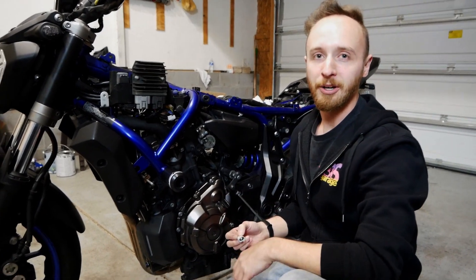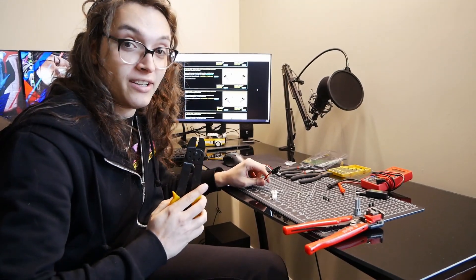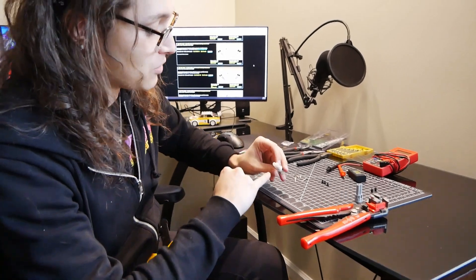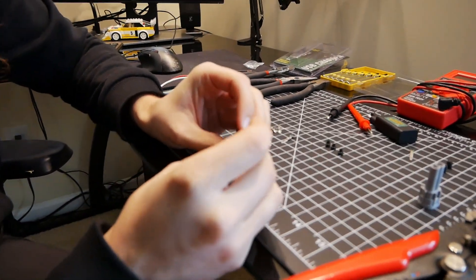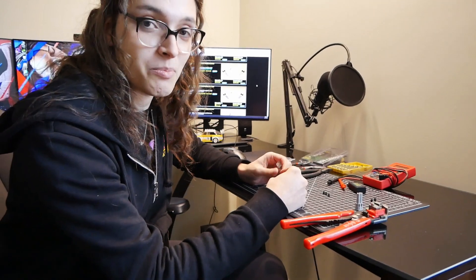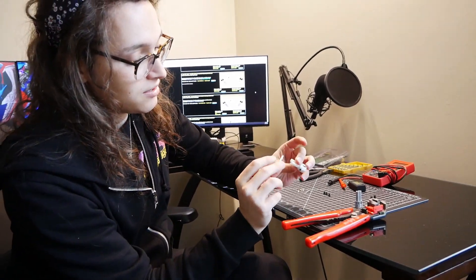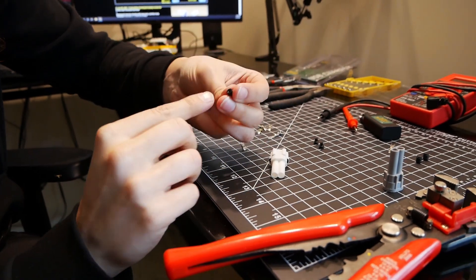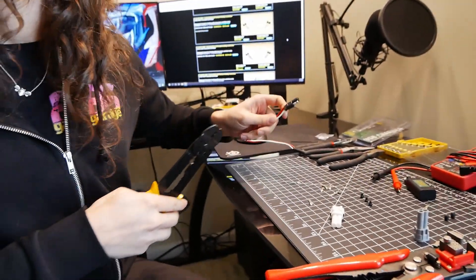What we can do is wire into this so that we have something that just mates up. We're going to go upstairs to another workbench to actually do the wiring. I'm going to wire up the connector for the USB charger. On the female side of the OEM connector, it doesn't have any of the metal terminal bits that you need. You can actually order those online — we'll include a link in the description. I'm going to do some cutting, some sticking, some stripping.